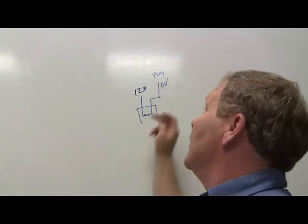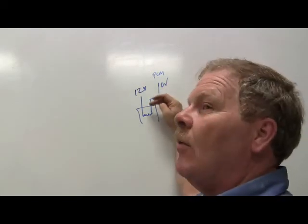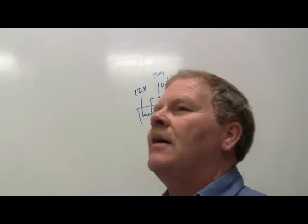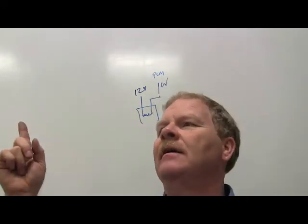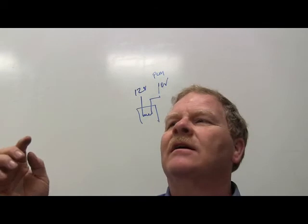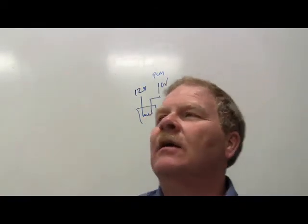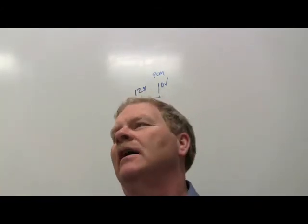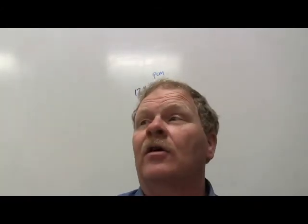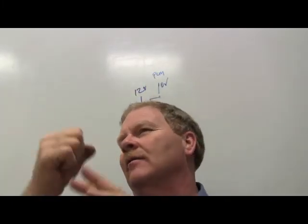Daniel had an open circuit in the wire between the PCM and the oxygen sensor. It wasn't a long run, probably 2 or 3 feet. So he got another wire and hooked it into the pin coming out of the PCM, and he ran it down to the oxygen sensor. He soldered and heat shrinked, which Daniel just loves to do, and that's a good thing in this business. He put it inside and it looked like a factory job.